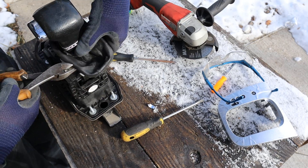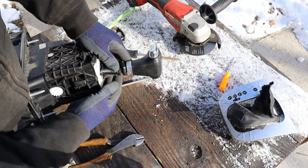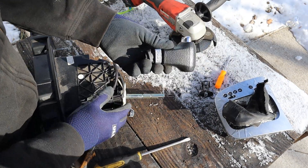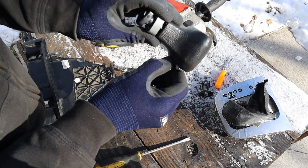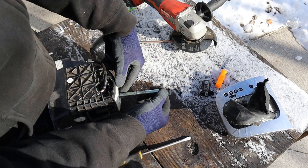I'm going to try to get this boot out of the way so I can see a little better. I'm going to break this plastic piece off here. I've released these clips here — now you can get the shifter head to pop off. Now this button here, which used to be spring-loaded — when you press it, it actually pulls this piece up, and that's what allows you to shift through the interlock.